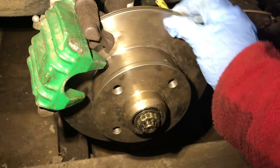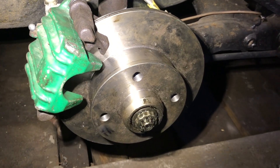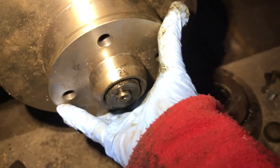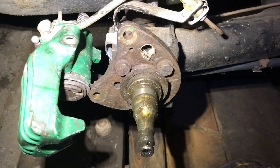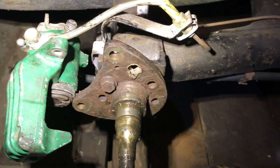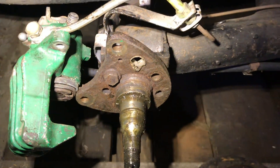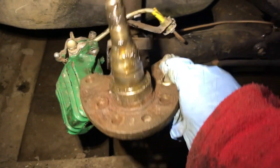Although we did a great job installing the brand new brakes, now we're going to strip all of this off and get ready to install the newer new brakes. With the caliper just removed and the carrier removed as well, give it a shake — the bearing is ready to come off, and now the rear brake should come off. Looking at our stub axle, we have to remove these four bolts. Mine came off easy enough as there was plenty of copper grease in there, but if yours don't come off, use loads and loads of heat. That's the old stub axle removed.